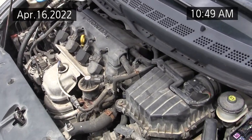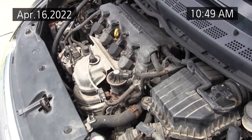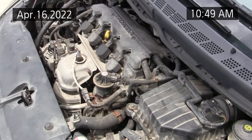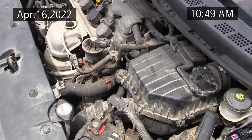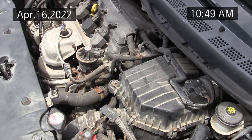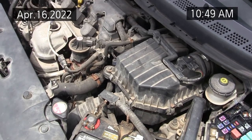The guy swaps an engine and finds out it wouldn't run. Some minor difference in the VIN numbers. Anyway, beware of that if you swap engines. Research it thoroughly, the VIN number compared to the engine serial number, whatever.